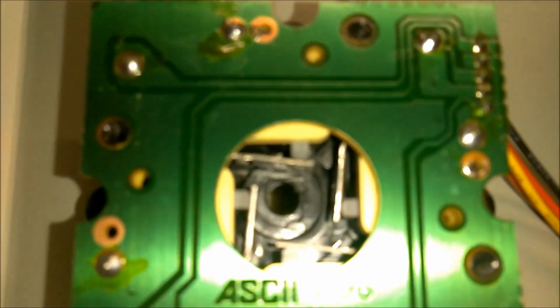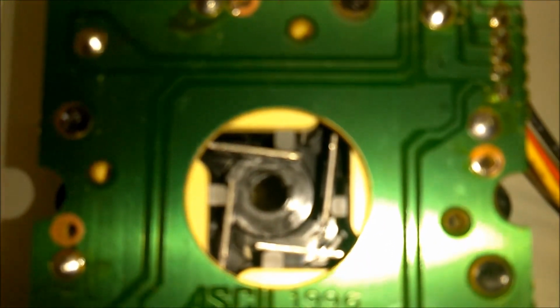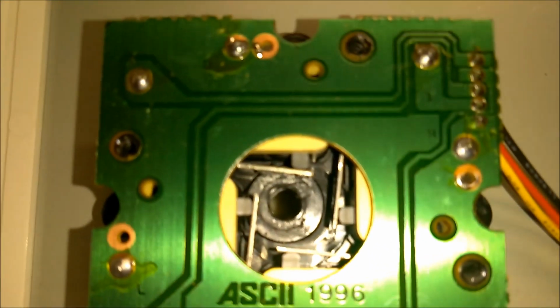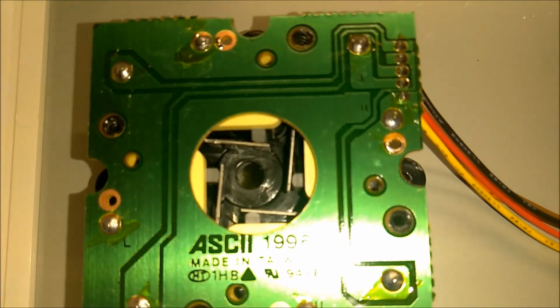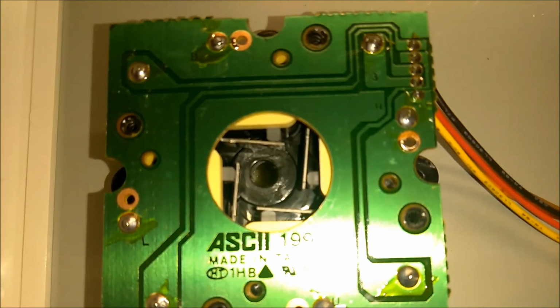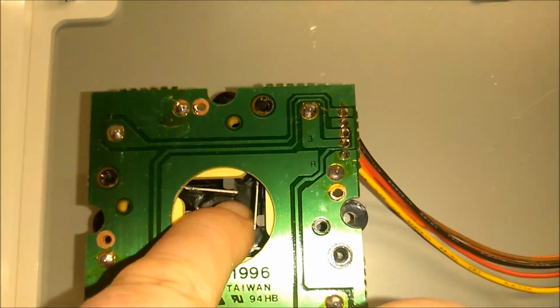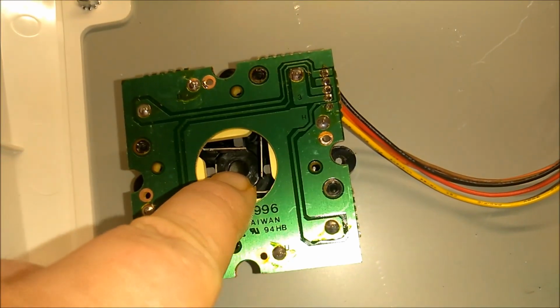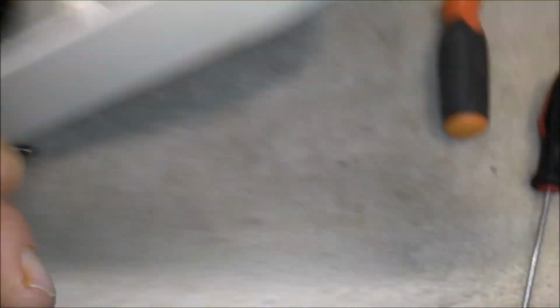A note on the super important spring stopper, or spring catch, that black washer down there: the flat side goes outward. What I mean is pointing toward the camera. There's a slightly humped side on the other side. It gets thicker toward the center, and that basically helps it pivot in the hole. And then this is what your spring sits on top of, and then the actuator is on the other side, and then you have this white part here, the pivot,